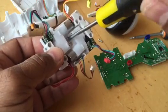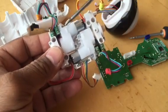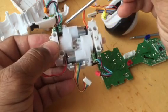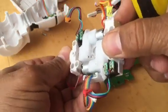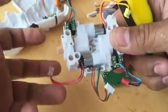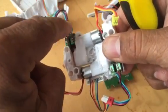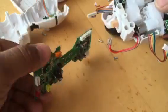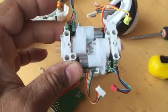There are two screws holding the motor case here and two screws here to take this apart. Try not to touch the PCBs, as that could damage the electronic circuitry. That little black wheel is an encoder — when you turn the wheel it selects different programs. It connects up to the PCB and to the onboard computer to set up different programs according to what you require.